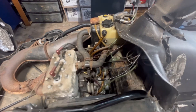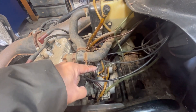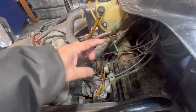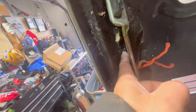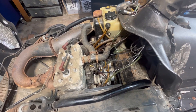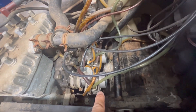I did see that they make a plastic box with two holes that attach right on the carburetor mouths, which goes into this plastic air box. It coincides with a foam filter when you close the hood. That used box is about twenty dollars, which I could just get if this doesn't work. But I decided to get a couple of air filters and try to fabricate them to fit right over the mouth of the carburetors.